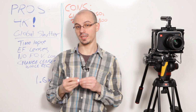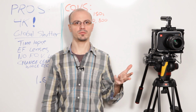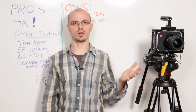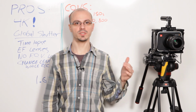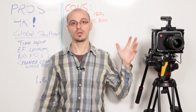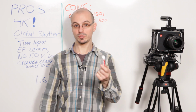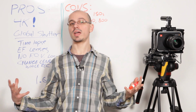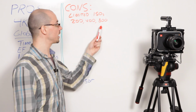Whereas with the 5D and the 7D, you have 100, 160, 250, 320, 400, the list goes on and on. 640, 800, 1250, 1600, 2500, 3200. You have a million to work with, and they all go in 1/3 stops up. So if you're used to the 5D and the 7D, you have a lot of ISO room to play with. With this, 3 steps. The brightest you can get is 800.